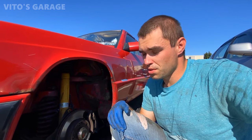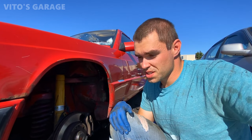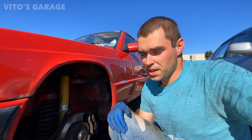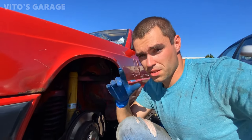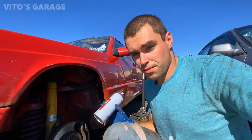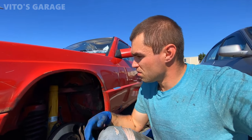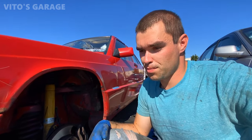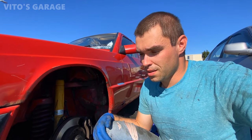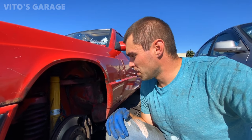That's why a lot of these cars rust out — because people don't know the best anti-rust protection. They only know about miracle paint, which just covers everything up. But again, if you see any rust, you have to clean it off, wire wheel it, primer, paint it, and only then fluid film and grease it up. Don't listen when people say just put miracle paint on a rust spot — you're putting a band-aid on it. You must treat the rust and then preserve it with fluid film and grease.